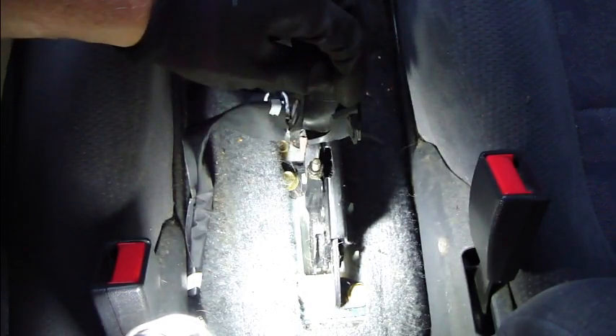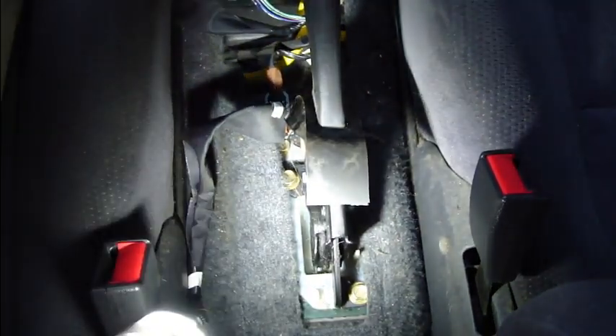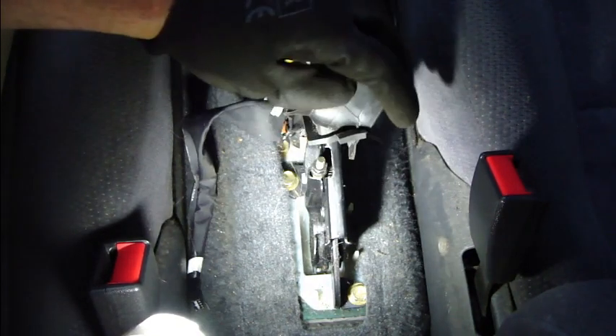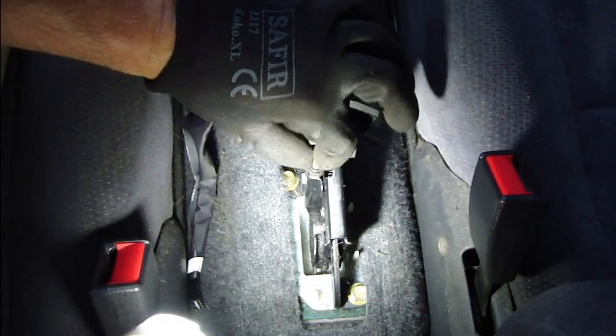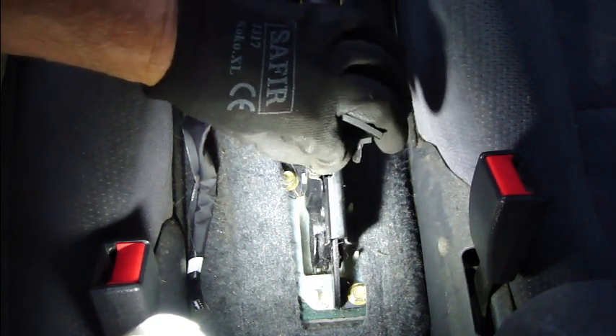Now they are tightened and I'm very happy. There is an accurate picture of this wire and those nuts. Now this is fine. Then we need to do the assembly — we install the cover and wires back, and then everything is fine. This was the work: how you can set up and tune and do this handbrake adjustment. You can tighten this wire. Thank you.